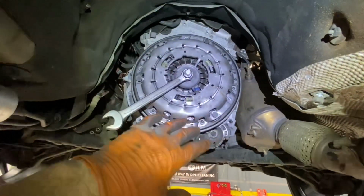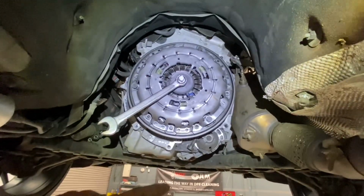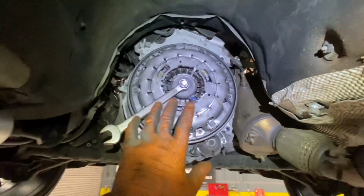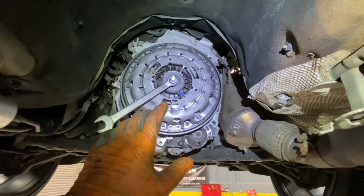Okay, pressure plate bolted on, 6 bolts torqued around the edge with my Milwaukee power tool. And at this point in time, I've nothing to worry about my clutch disc being lined up right, because I know it is, because I stuck it on with a little touch of super glue.